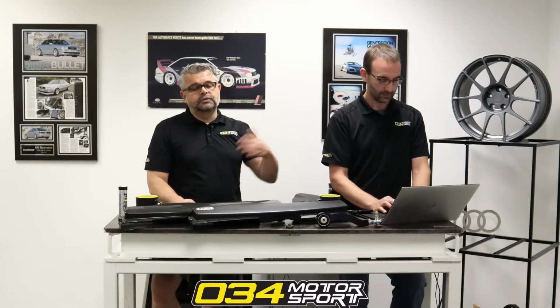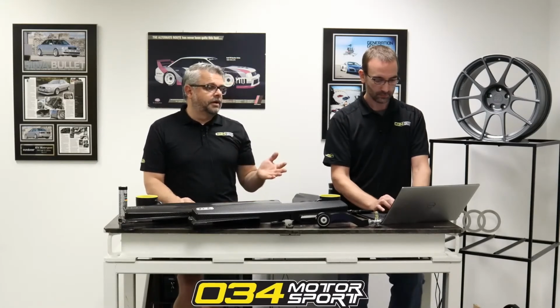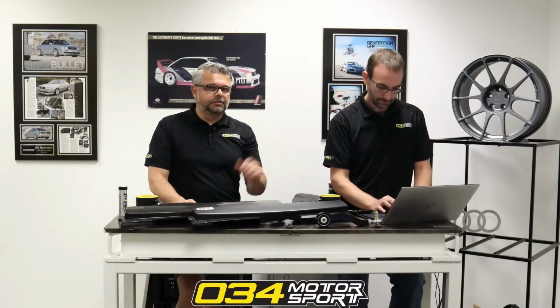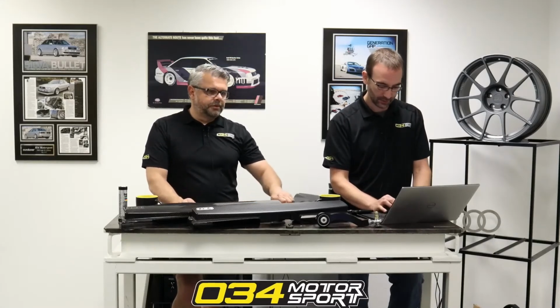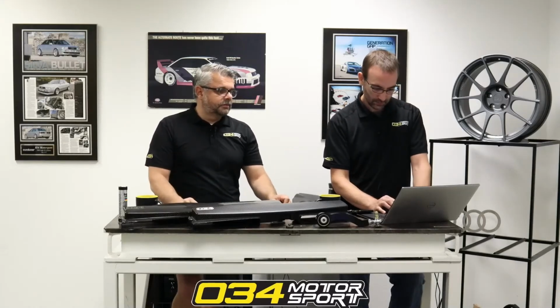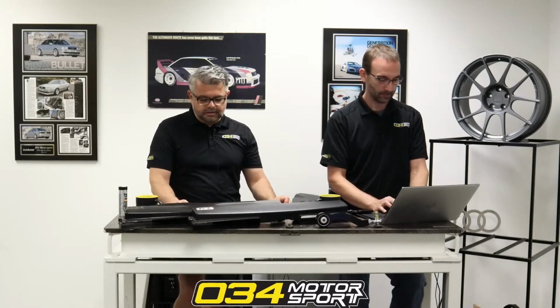We actually used to sell upgraded clutch packs years ago, and when we finally figured out what was going on, we discontinued them. Oh yeah, for the DQ250 stuff. Yeah, because again, the DSG tuning was not good. That was before we offered DQ250 tuning. But the well-known major tuner was pushing clutch disc upgrades as a necessity mod, and it wasn't.